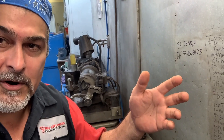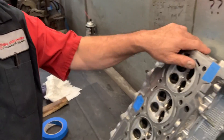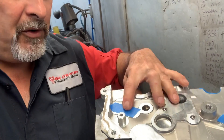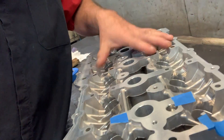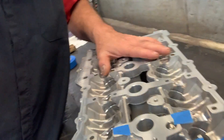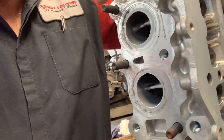Tip of the day: if you're just doing a quick clean simple job and getting rid of all the carbon out of the ports, what do we do? Tape up all of the holes that go to oil — anything that has a tensioner, the oil-pressure-fed tensioners, the feed lines up here on top that feed the cams — anywhere there's oil pressure, tape them all up. There's no need to glass bead up here; it's right out of the spray washer and looks nice.